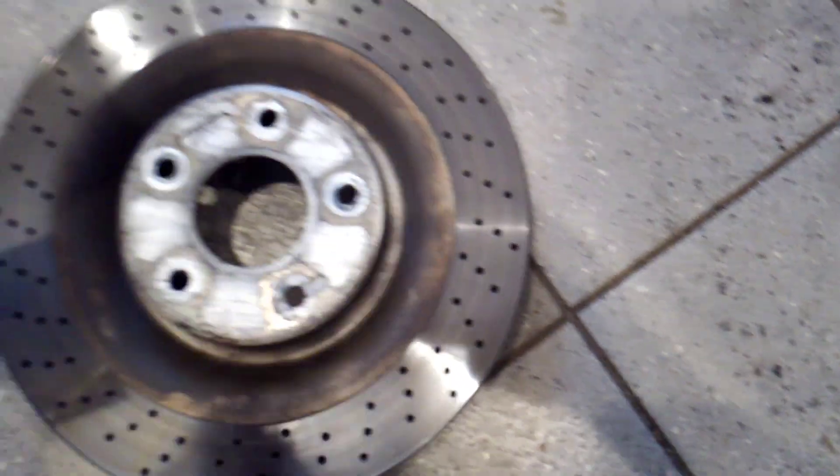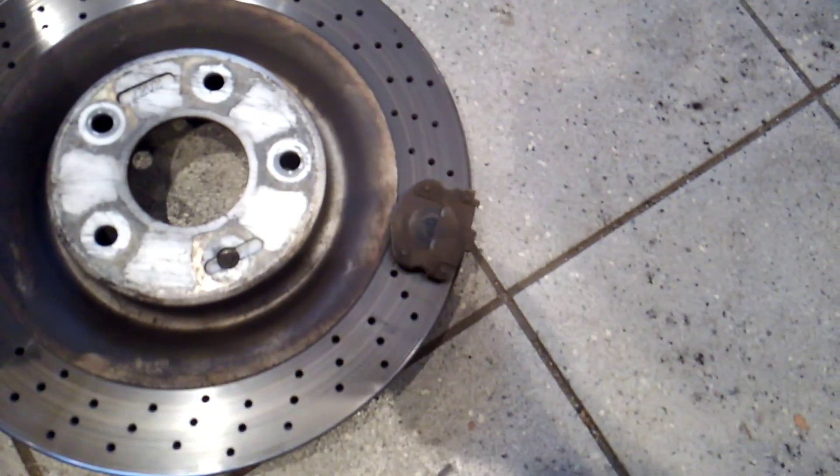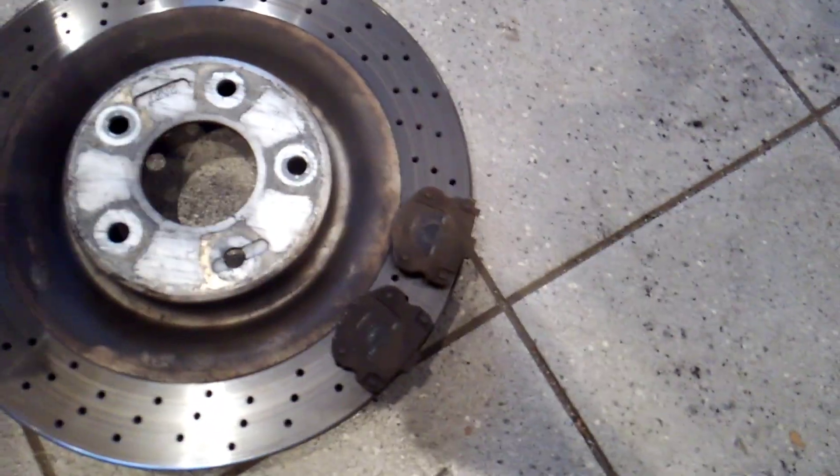Here's the issue — you could still see a whole lot of brake dust inside the brake rotor. What happens is it will contaminate the brake pads as they slide across it, creating more brake noise.